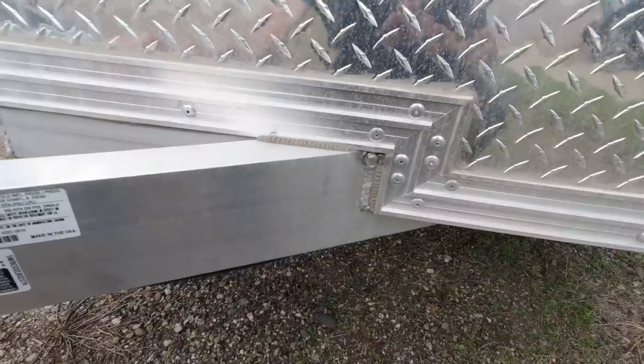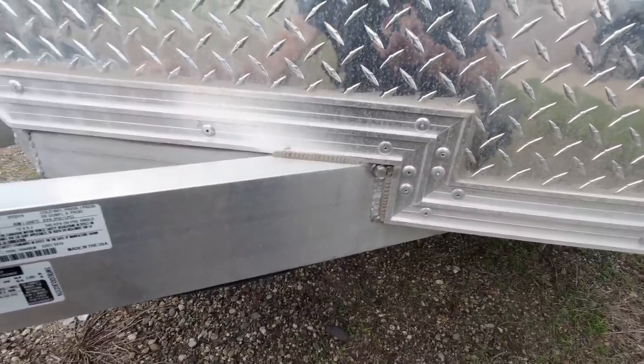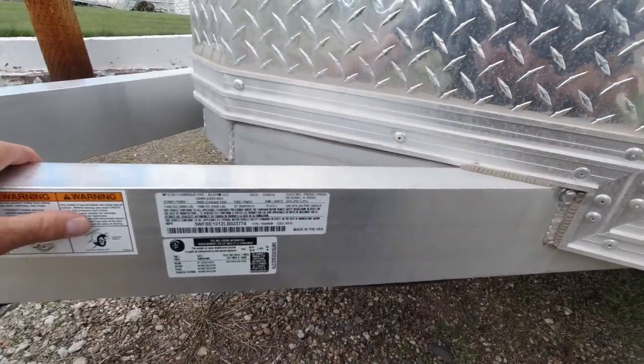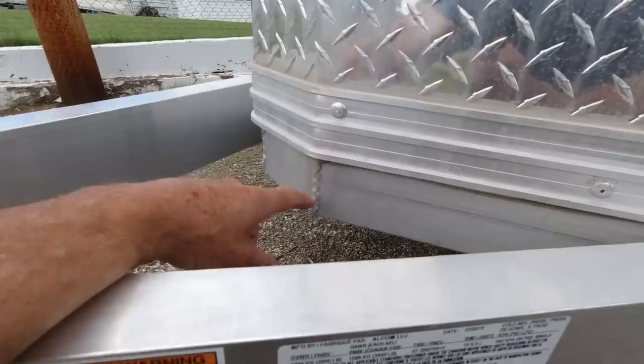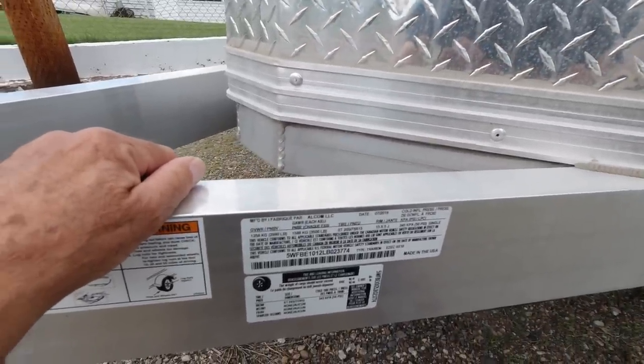When you're buying a cargo trailer, one thing to look for when you're looking at it on the lot is things like the quality of the welds. These are things that you can easily see. Make sure they're not all splotchy and that they're nice, even, well-done welds. Get underneath the trailer and look at those welds too.